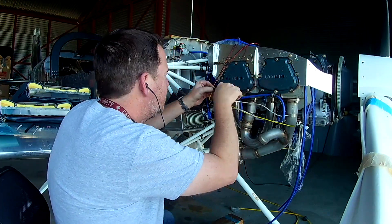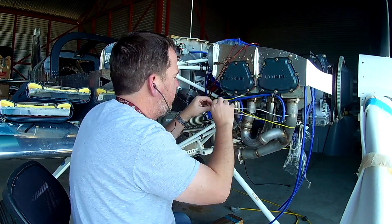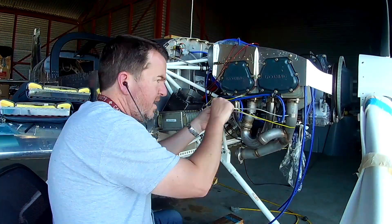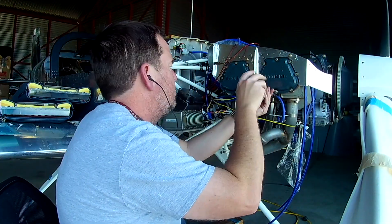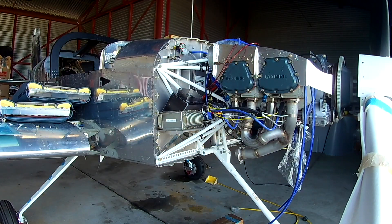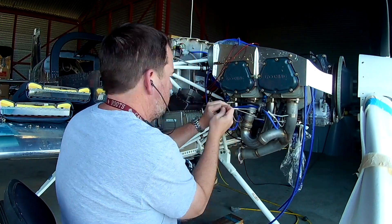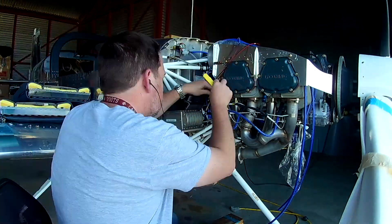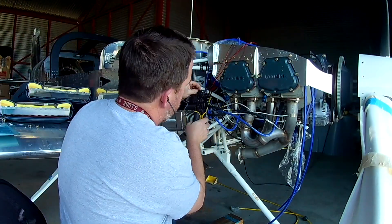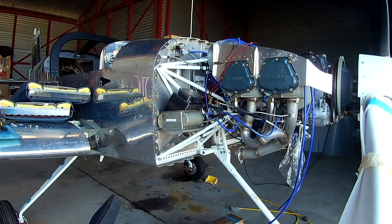Read the instructions very, very carefully. This is why you always need to have a complete numerical drill bit set. What you do is drill a number 32 or 31 into the exhaust, again perpendicularly. I use a little hole punch to make a dent first and then drill there. Once you've drilled, you're going to put the probe on and start tightening it up. It's a stainless steel pipe clamp — you can use a flathead screwdriver or a 5/16th socket. As you tighten it up, the seat of the probe squeezes into that hole and seals itself. If it doesn't want to go in, you can take a little piece of wood and a soft hammer and give it a little motivation — that usually pops it in place.